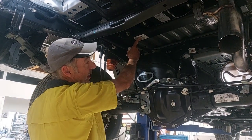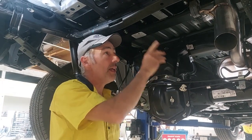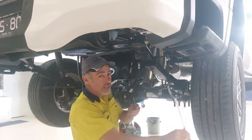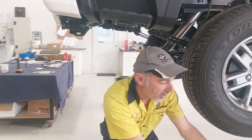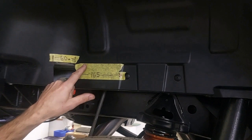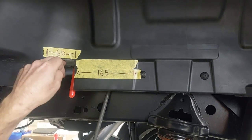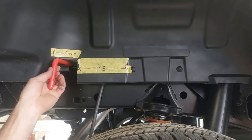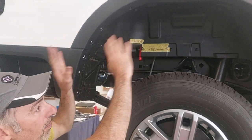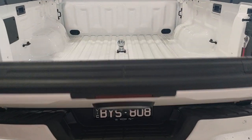You've got your ID plate and sticker there, and this sticker goes on the door pillar of the vehicle. The last job is to install the handle — the handle goes through from the driver's wheel arch and you put the R-clip in the centre box. Using the screw hole as a datum line, come straight across 165mm and cut a 60mm gap in line with the floor. The handle comes out and moves to the rear so you can remove the ball and back in. Put your fenders back in — that's it. The next-gen 3.5 tonne towing kit from Fifth Wheelers Australia in Ballarat.